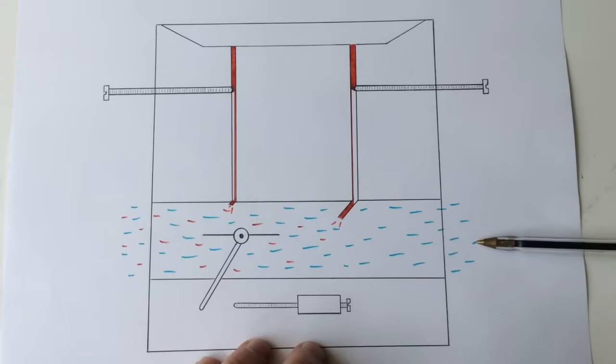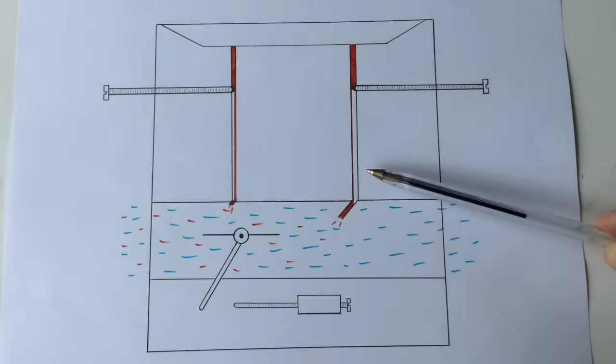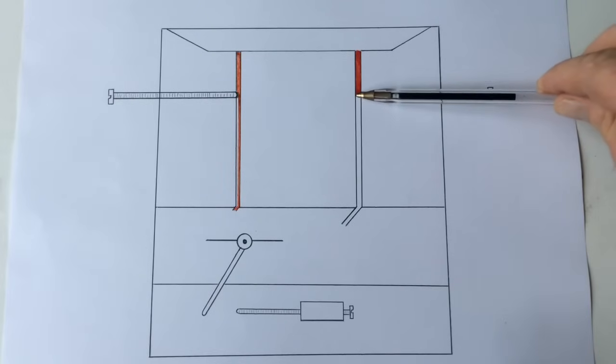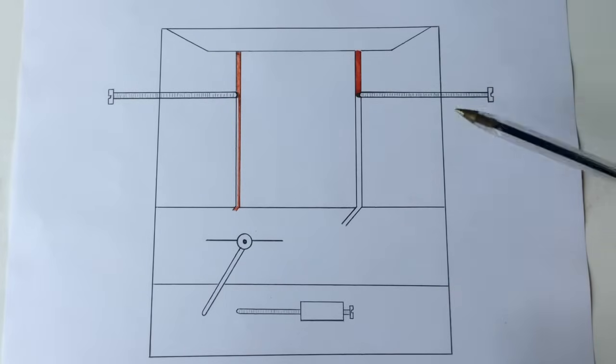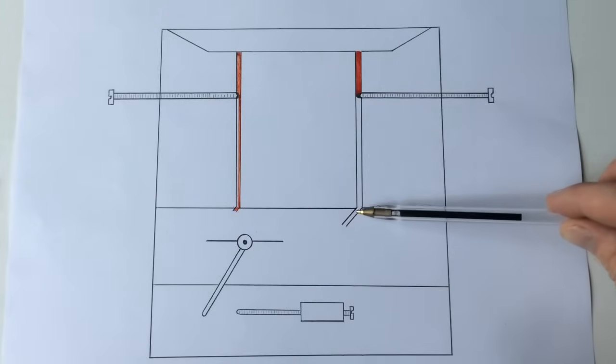And you can see we've got a bit less air coming through actually, because now we haven't got enough fuel for efficient combustion and the engine revs are going to go down again. When the engine revs are going down it also can't pull air in either, so something needs to be done when it gets to this point.